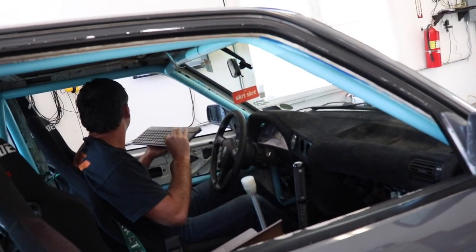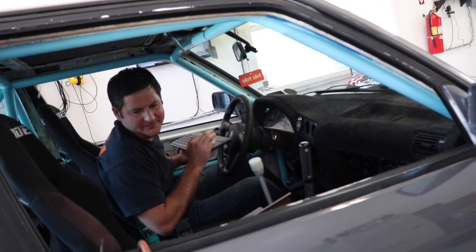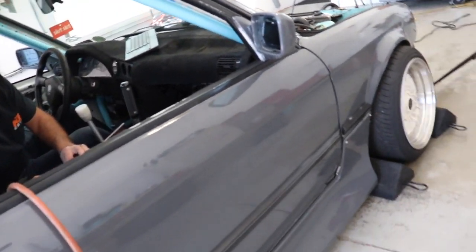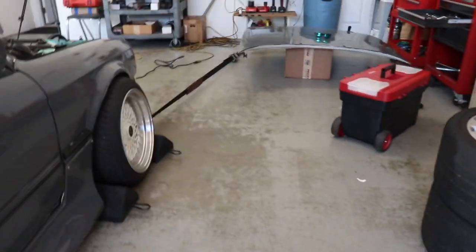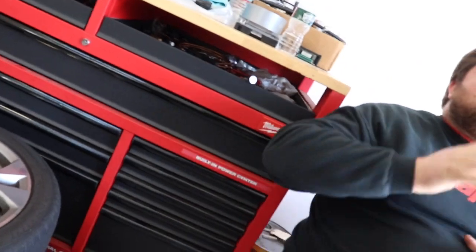I'll shoot you a text when I fix the wideband. I would get it done as quick as possible because we're kind of chasing around and I think it'll be good to get it cleaned up. I have a bad wideband sensor — that's why we were getting some bad readings. So when we went to tune it, it would actually adjust it the wrong way and blow out the spark. I've got to fix that, come back, and then we'll make some real horsepower. But for right now it's reliable and driftable and we'll be at the next drift event, so I'm pretty excited.